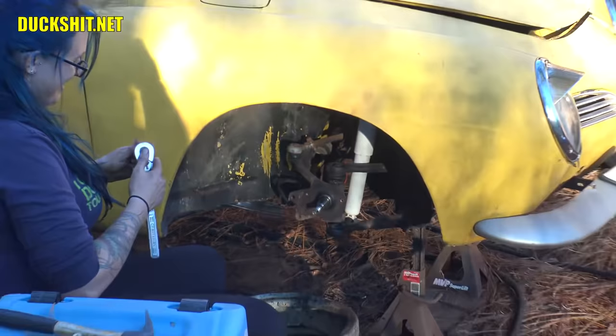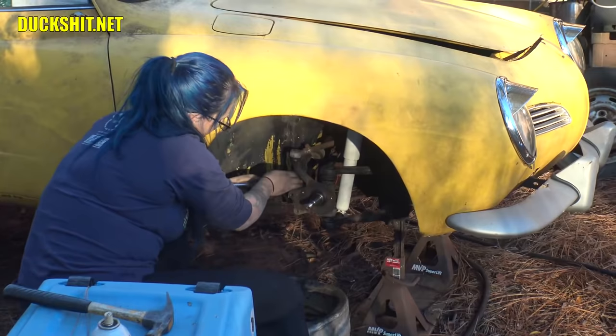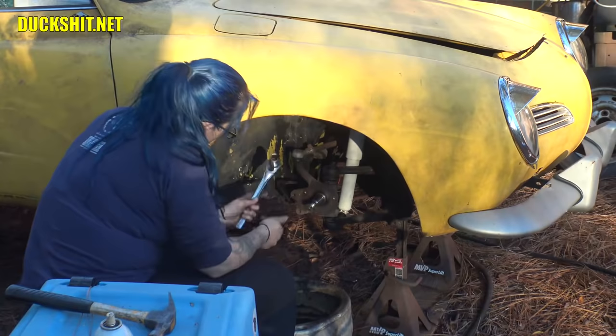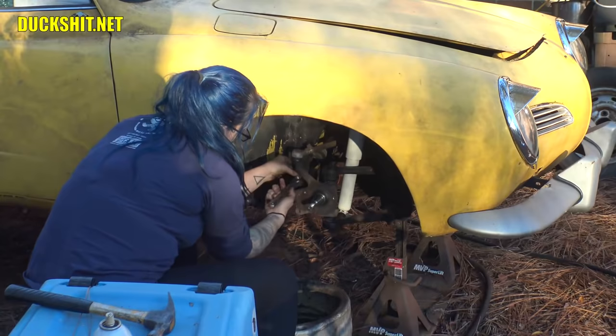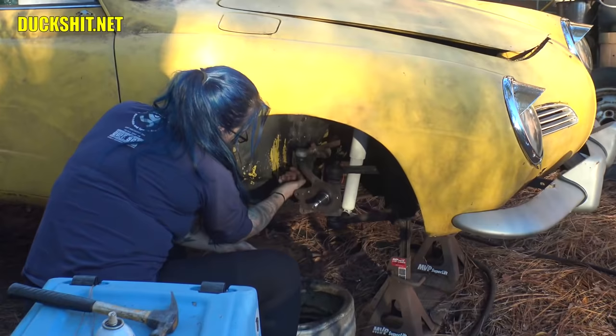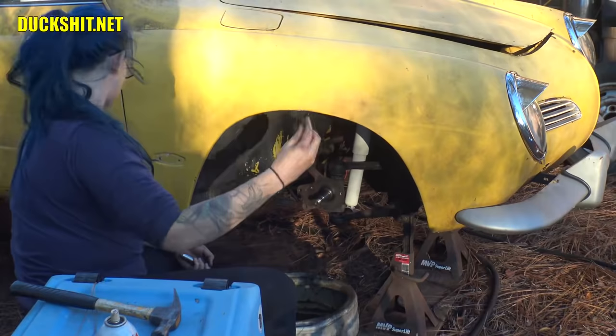Castled one? Yeah, it's a castellated nut. Sometimes on those nuts, you'll actually find a place where you can put in a cotter pin to stop the nut from turning. And those appear to be missing them. So there's no cotter pin to stop it at all. I don't know if it was omitted by the previous owner or if the little ball joint on the end of the tie rod there is missing the hole, perhaps, which I've seen too. So I'm a little uncertain. Yay, look at that. One castellated nut. Drop that down there in the can so we don't lose it.